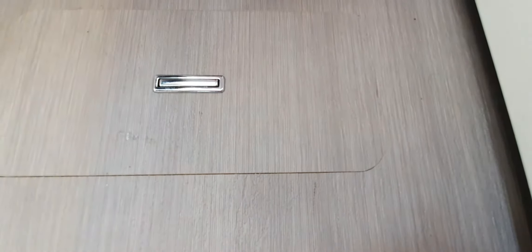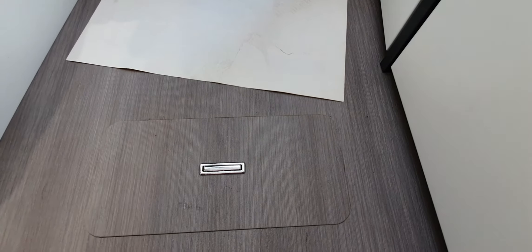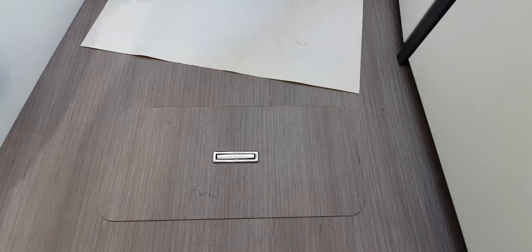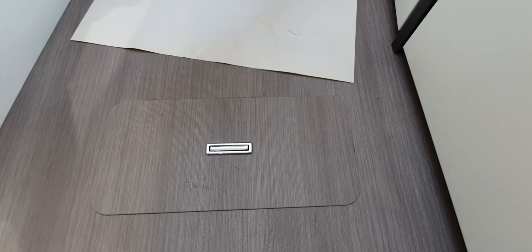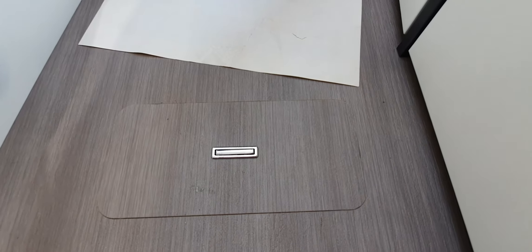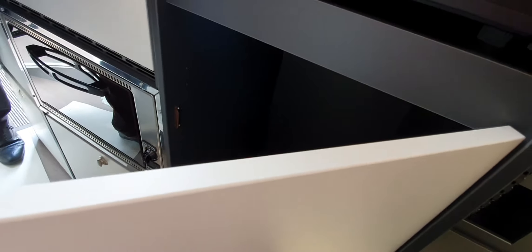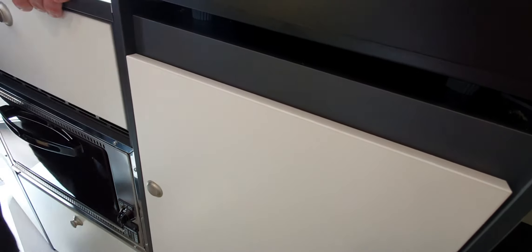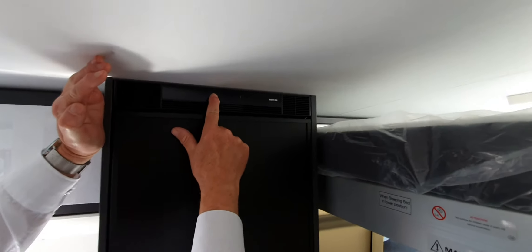Down here, this little cubby hole is access to the water system. See these little fellas — one here and one here? These are the two lowest points in the van. So when you come to winter time and want to drain the system totally, you take the water through the sink waste into the waste tank and empty it. Anything that's left will be in that little section — just simply open them up and it will drop straight out to the floor. That is basically the system empty.